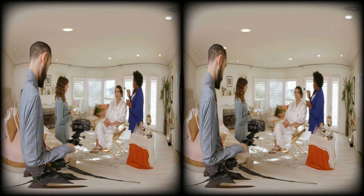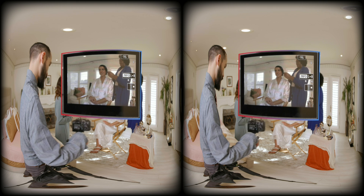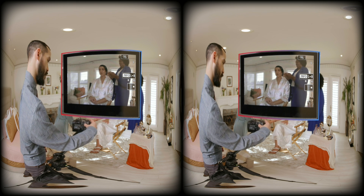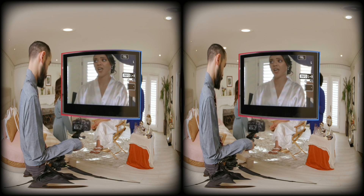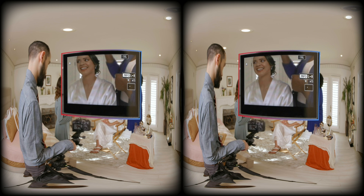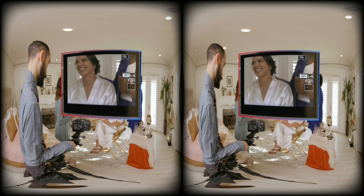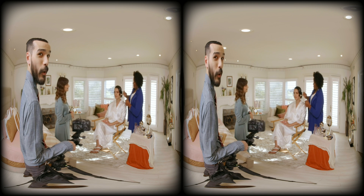We also added the magnify function, allowing you to magnify each side of the lens independently. Simply press the magnify button to go from 6x magnification to 15x magnification. Press the info button to switch to the opposite side to check it as well. You can also use manual focus peaking while magnified to provide a color overlay for your focus field.